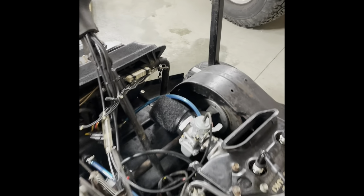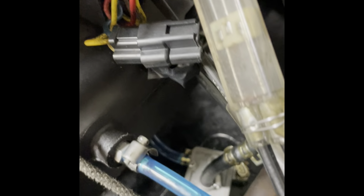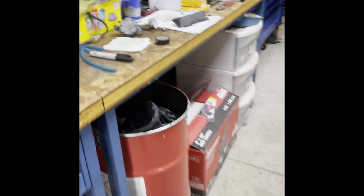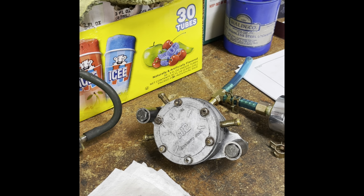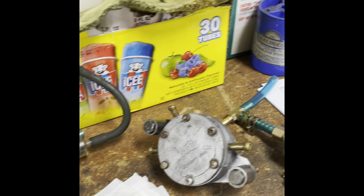But yeah, the fuel pump, I noticed it seems to be not pumping right, I'm getting air in here, so I don't know if we got a pickup issue still or back to a fuel pump issue. I might want to try this other pump again. I think the original pump was doing better, so I'm going to throw that in. Some of the parts I'd be selling, but I think I'm going to hang on to that and throw that in there. I did do a rebuild kit on that in one of the earlier videos. Run that, just curious to see how much better it puts out.